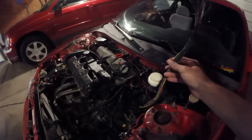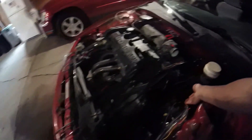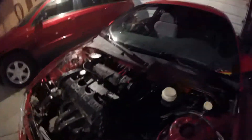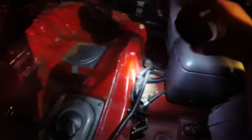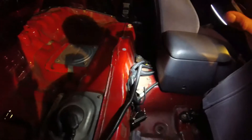Day two - I got the wire harness ran all the way through. Here it is in the engine bay. I have quite a bit more wire sticking out than before because previously the wire stopped around here, whereas now I have probably another foot, foot and a half of wire to reach stuff with, and I don't have the wire harness running up here so this whole area is a lot cleaner. The ground wires are pulled all the way out of the harness - that's five less wires and one less ring terminal grounded in the engine bay.